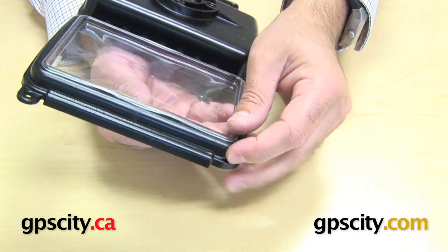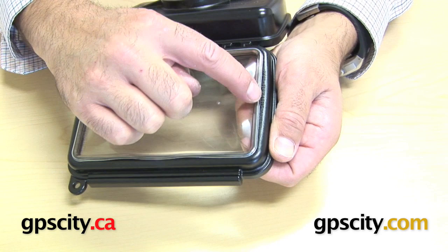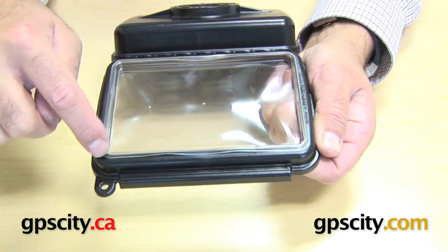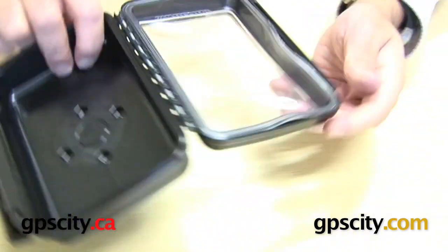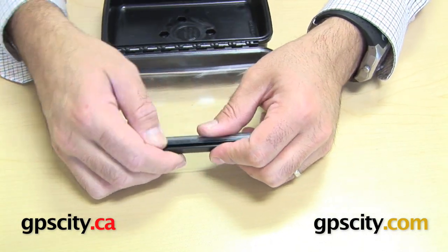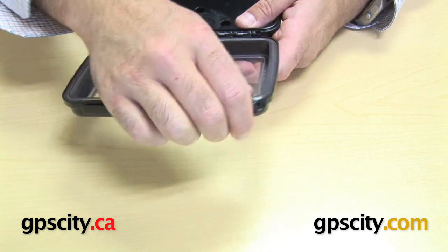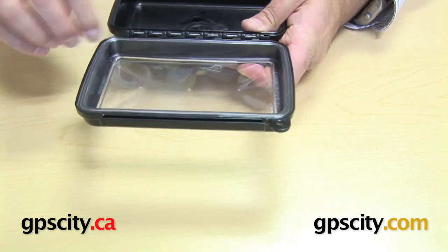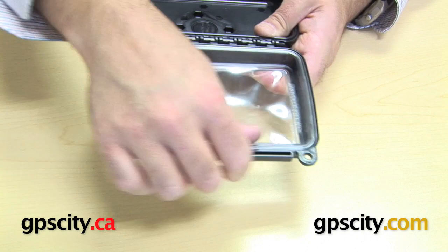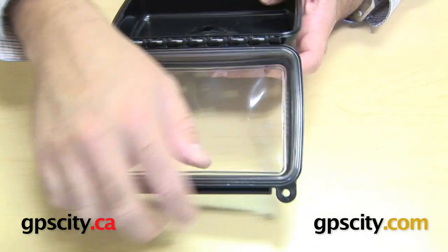As I said before, this is the same principle for all of them. You can now see the lens has a lip around the edge of the cover here. Let's go back on the inside — you can see it's just popped out here, so let me just push that back in. All these edges go back in, and there you have it. It's very simply into this gap or the opening, and I'm just going to double check everything. All the lip in here is now sealed.